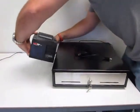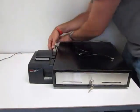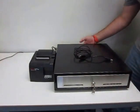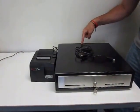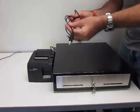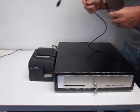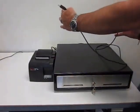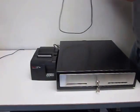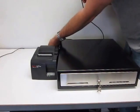Go ahead and route that, and take all your excess cable and pop it straight underneath. A lot of people drill their hole underneath maybe just the center of their cash drawer. You're also going to have your USB cable, which comes from either your all-in-one unit on top of the terminal — that'll route through and connect directly to your receipt printer itself.